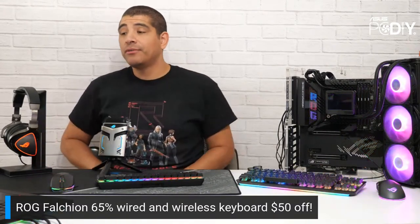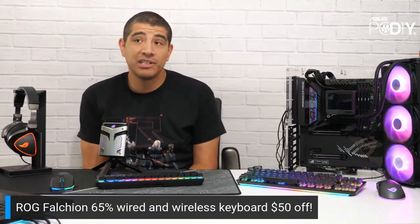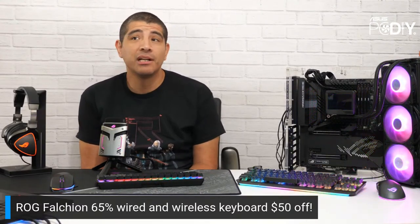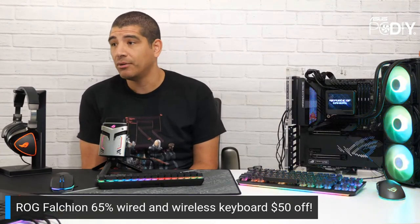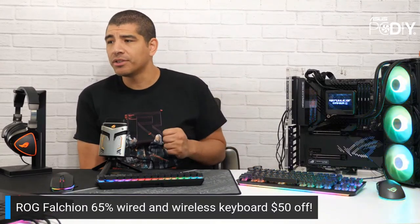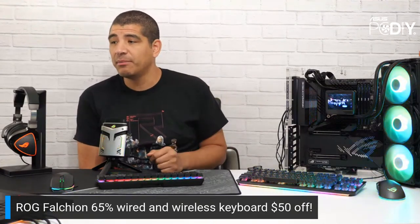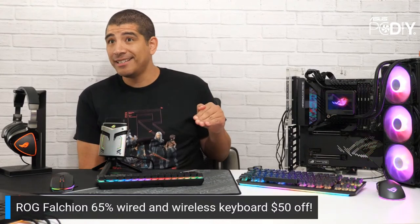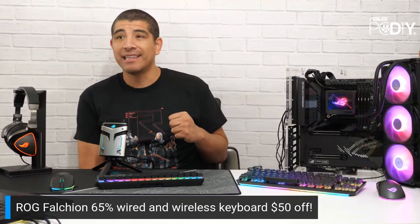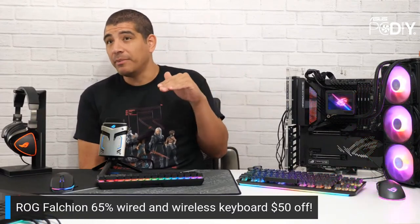So yeah, if you've got a 240 hertz monitor with the 7700K, especially because you have it overclocked, you're making up for the fact that you're losing a little bit of frequency compared to more modern CPUs. Generally, for most generations, we've seen an uplift of about 10% per CPU generation. You've actually jumped up quite a bit, especially if you have that across all the cores, and also if you're running overclocked memory. So that means you've still got a pretty strong CPU in terms of its overall gaming performance. And going from a 1660 Ti to a 3080 would be a massive uplift. Even though you don't have PCIe Gen 4 support, you would still see a massive uplift, not only in your peak frame rate, but critically in your minimum and your average frame rates, right?